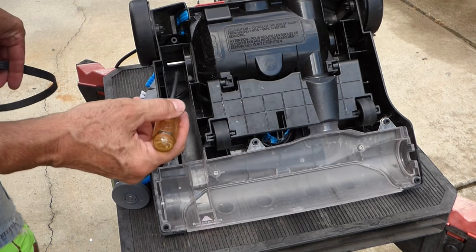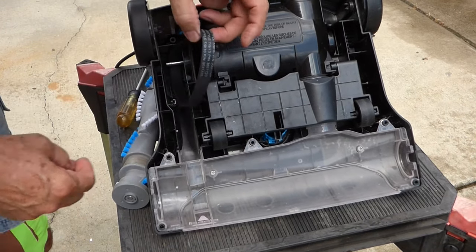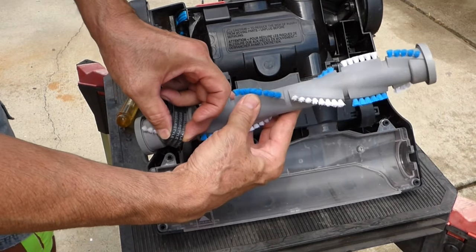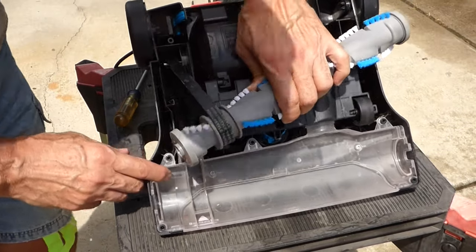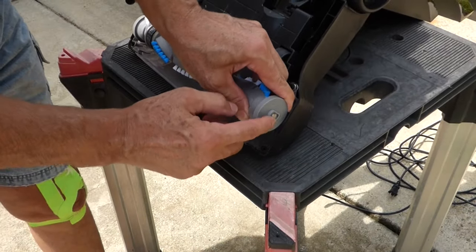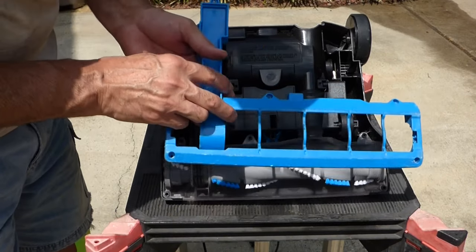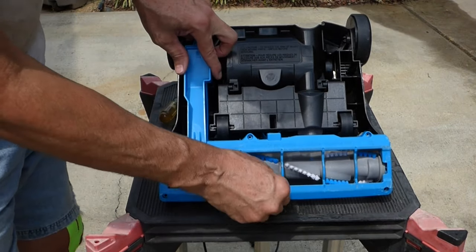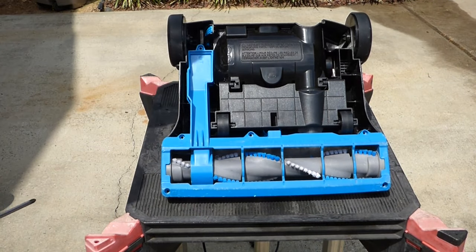Next, we'll put our belt on. The belt goes around that drive shaft from the electric motor — you just twist it and set it in there, just like that. Then the roller brush. The belt side is round so you can't mess that up — that just slides in there. We'll stretch the belt — we're in. The other side has this squared-off nub and it just slides in like that. Next we'll put the belt and brush cover on. This is the only hook, so you hook that on and slide it in. And now we'll put the screws in — they're all the same length, you can't mess that up.